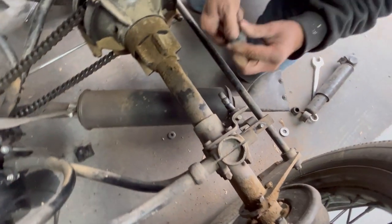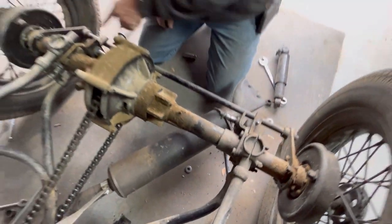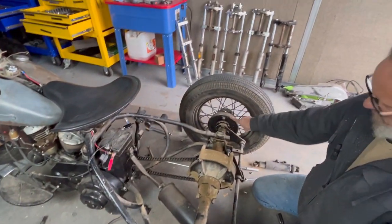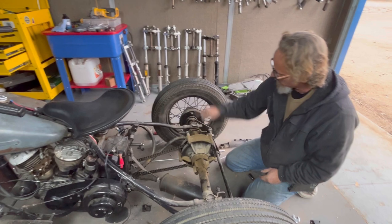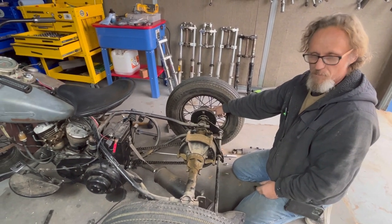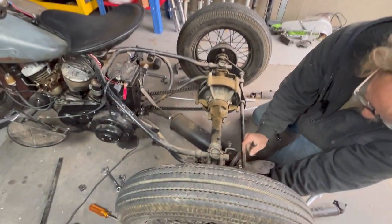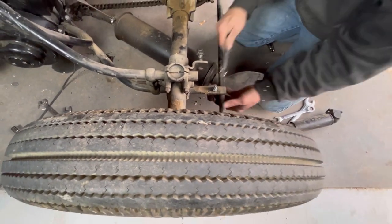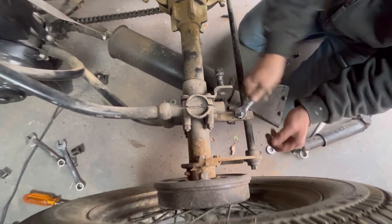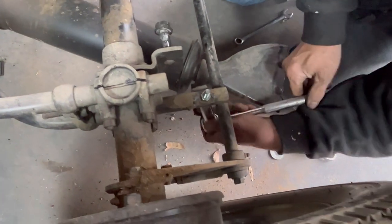You can see these rubber bushings — they're just beat. I've got to go through there and steel wool all that, clean all that up, re-oil everything, lube the chain, paint everything, pull the wheels off, see what the brake shoes are like. In the videos last week about putting parts on the shelves, I found two or three boxes of new old stock 45 brake shoe linings and some brake shoes — I'm going to check them. Just amazing how much stuff I've been able to find in that box of parts. This holds the back of the muffler and I don't want that muffler bouncing around, so I'm just going to snug this on for temporary sake. There we go — just so that doesn't bounce out.